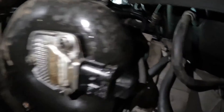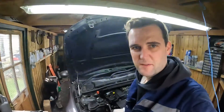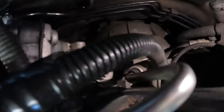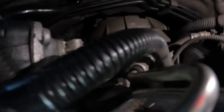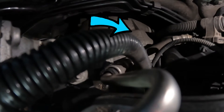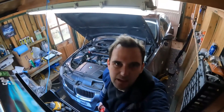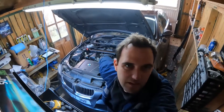So I'm under the car - there's our old friend the oil level sensor for reference. I can just move up the side of the engine. I think that's the crank sensor in there. I'm going to take the scuttle panel off just to give me a bit more visibility from the top. It's impossible to see hardly anything down there - you can just about make out where the starter motor is, but you certainly can't see the crank sensor.